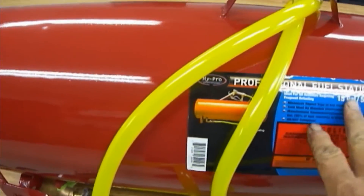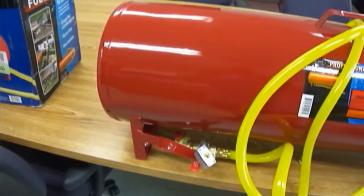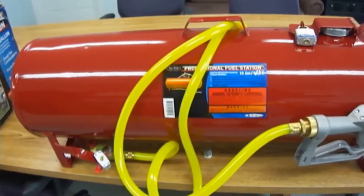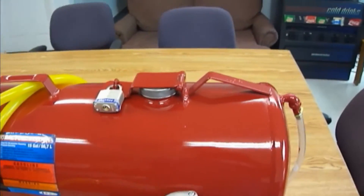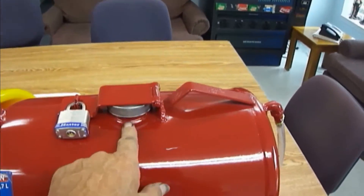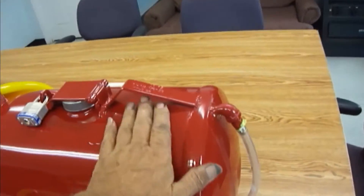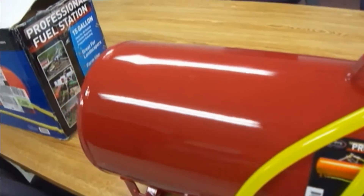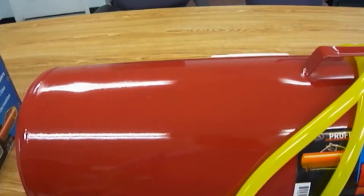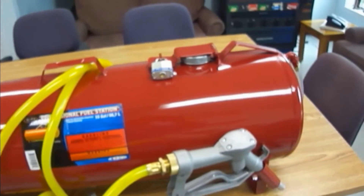I took off this decal, peeled it off with a heat gun, and I took it and put it in a media blaster and blasted all the paint off of it and repainted it. Some of you will say, won't the gas make the paint come off? No, not this paint — this aviation paint. Gas won't touch this paint here. It's been primed with super corrosion primer and it's got this good aviation paint on it — it ain't going nowhere.